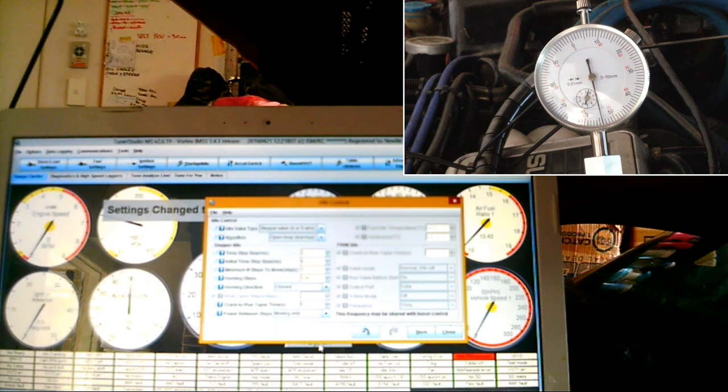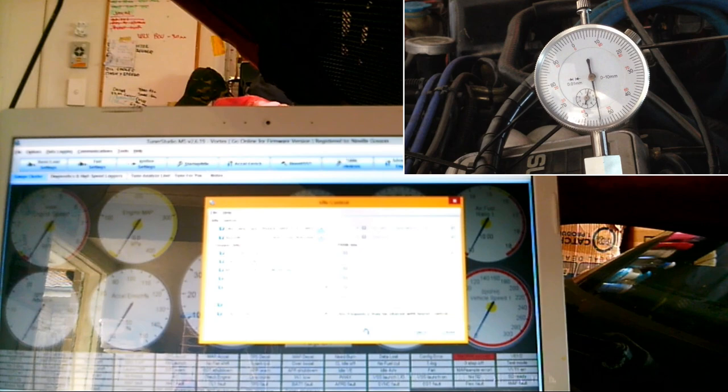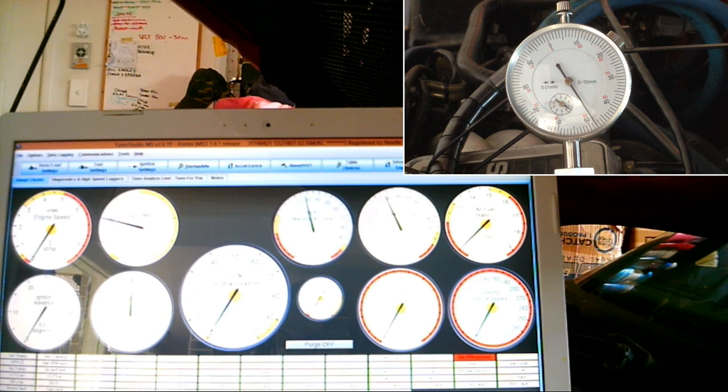On and off again. So it looks like it's going the wrong direction, so I may have to switch the polarity of that. Alright, so I'm just going to swap 1A for 1B and 2A for 2B. So what I've just done then is swapped the wires around. I put 1A in 2A, 1B in 2B, and vice versa. So now the valve should open the correct way.